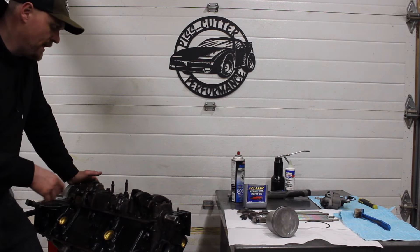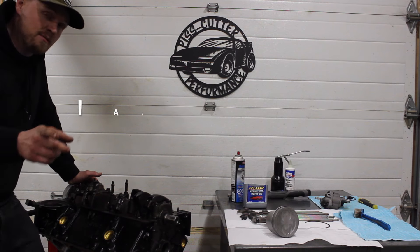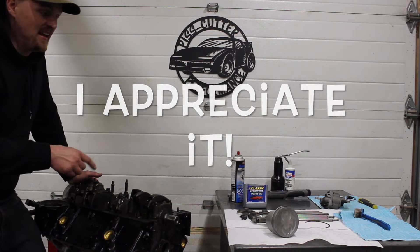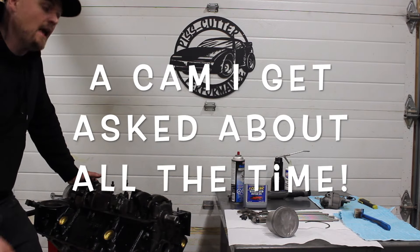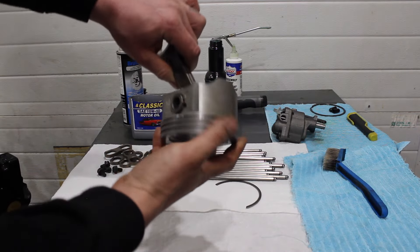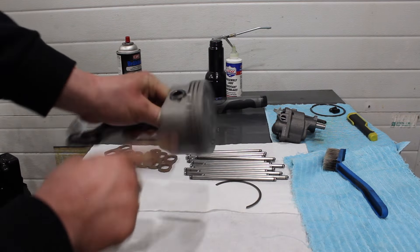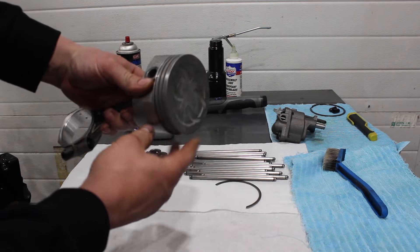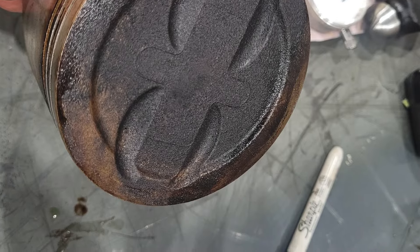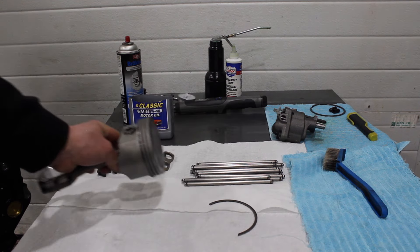There will be more videos coming up on this L31, but if you're into budget builds please hit that subscribe button because this is going to turn out really good. Wait till you guys hear about what camshaft we're using. But for now let's zoom in on this piston and take a look. This is a high mileage used piston — you can see on these Vortec some will have a little skirt wear, but this number six piston is in really good condition. I'll post the picture of what it looked like before — it's amazing what you can get with a good product.